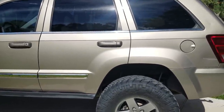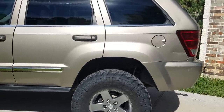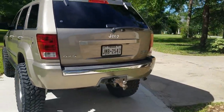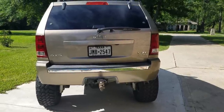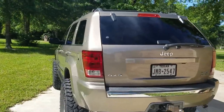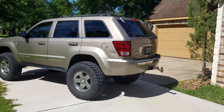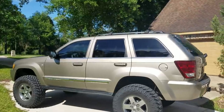There's not a lot of clearance for the 35 in the rear — mostly because it's a short-arm kit instead of a long-arm. With a long-arm kit I could get those wheels more centered, but once it flexes out with the short-arm kit the wheels center up in the wheel well. Moving to the rear, not many mods: a hitch, and I cut out the muffler and resonator and put a MagnaFlow muffler on. It's the 5.7 liter Limited with all-wheel drive, but you can go into four low and the differentials lock up — electronic limited slip differentials, kind of a poor man's locker.